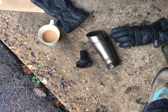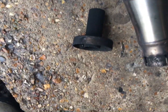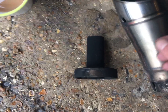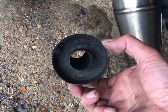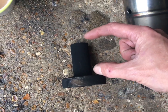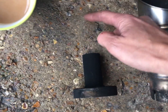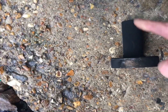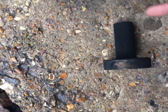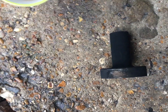Cool. Right, so that is the muffler off with the gloves there because the boat's going to be warm. Hey, look, let me come see. Yeah, not a great deal to it. It's just wadding around that piece. I'm slightly surprised that it isn't longer. No, I suppose that's about as far as it can be. It's only really stubby. So I'm going to cut the fiberglass round, wrap it to the thickness of this, pack it tight, and then see what happens.